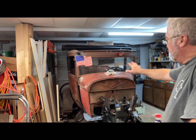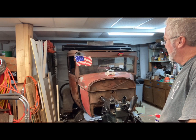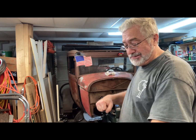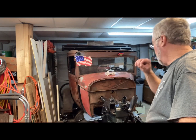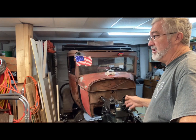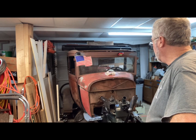And you can see in the video, I was just mocking up the cowl and the gas tank, and wanted to see the cowls over 60 years of dragging around through storage. They're very floppy. So it had gotten crushed before, and I just took it and bent it back to what looked like straight, a couple of months ago, actually, or last year even. I wanted to see how close it is, especially before you start putting paint on there, because if you flex it again, the paint might flake off because you're bending the metal.